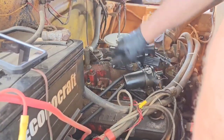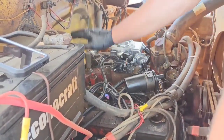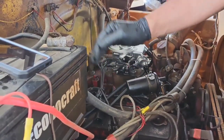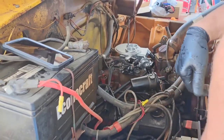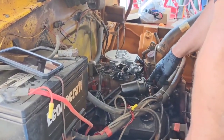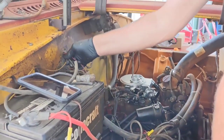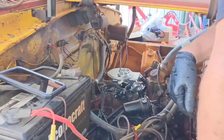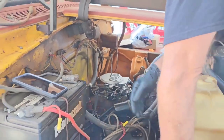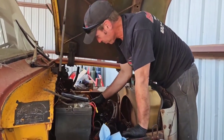Get that all cleaned up and make all of our electrical connections, which are going to be nice. Coolant temp sensor's right there. Wideband oxygen sensor right here. Both our battery connections. Then all we've got to do is find a distributor signal to come from right here, and come in through this hole, which I'll put a grommet around as much as I can. And we've got to find an ignition hot signal, and that's it. Things are pretty simple.